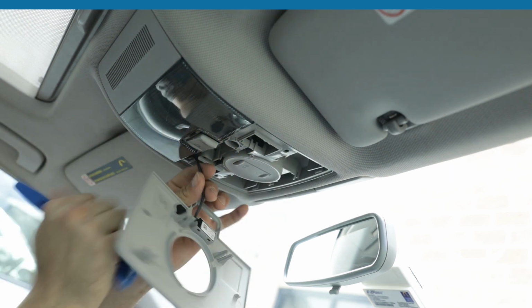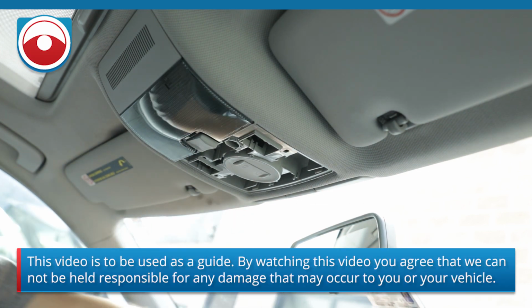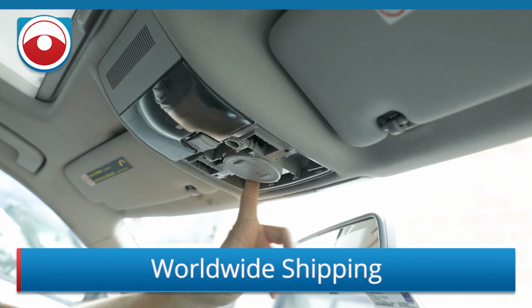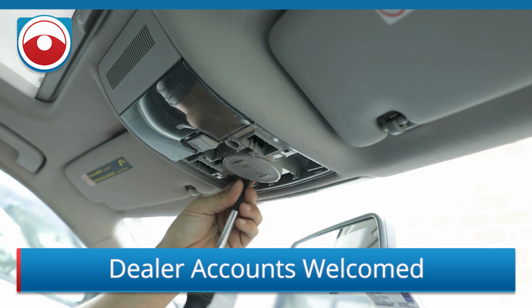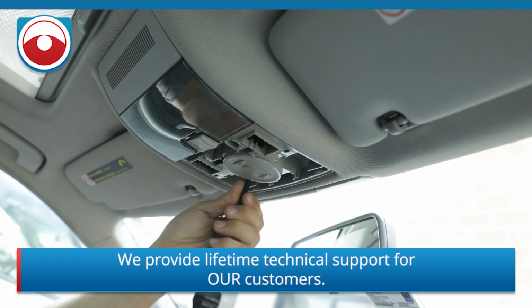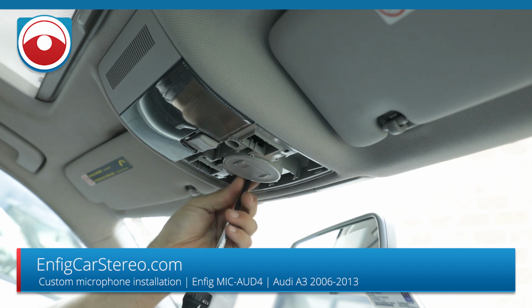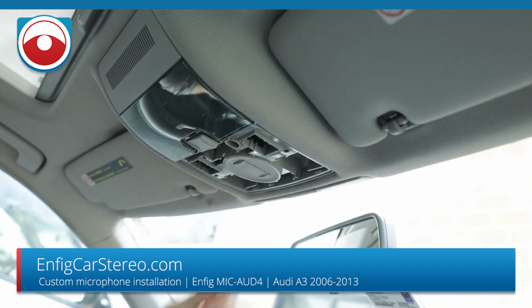All right. Now this is the factory microphone. You can just unplug that by pulling on it. So it just unplugs. Now, in here, more towards the center, you are going to see 2 holes. That is where there will be, usually, 2 10 millimeter screws. This is 10 millimeters. Usually 2 Phillips heads. This is weird. I don't know why Audi did this, but there's no other Phillips head screw in this car. They're all usually Torx. Whoops. There it is. Got it. This one is a Phillips head.